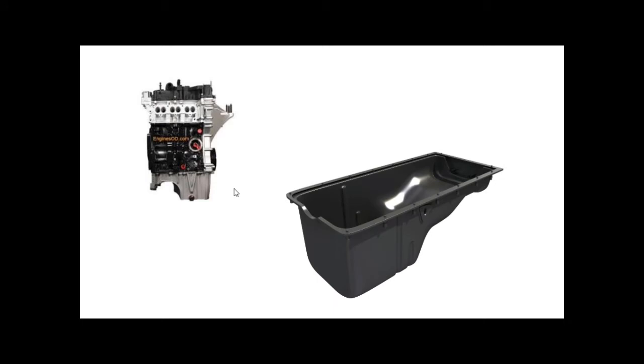Here is an image of an engine with a wet sump system. You can see the sump on the bottom of the engine. The oil gets pumped around the main body, lubricates all the bearings, then drains back and is collected — running from the back to the front — into this reservoir called the sump, where the drain bung lets us get the oil out.